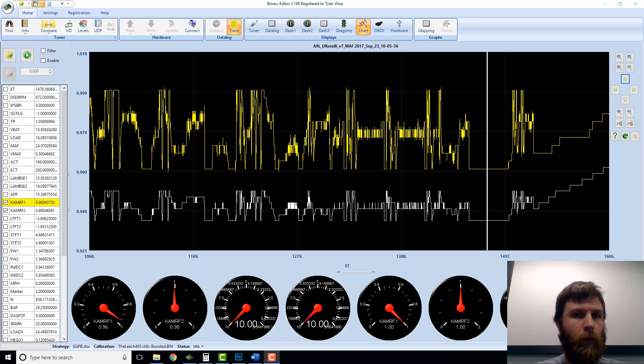That's one reason you might try to run off of one. The other reason is if you do stuff like a turbo and you end up needing to install a wideband on one side or the other, and you aren't going to tap an extra bung so that you can still run both factory O2s plus a wideband — something along those lines. Those are some reasons you might want to do this. So the question is: can it be done, and if so, how?